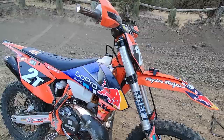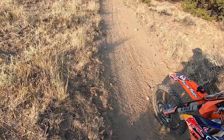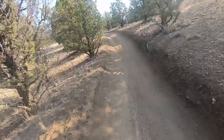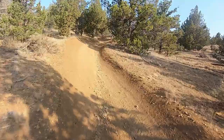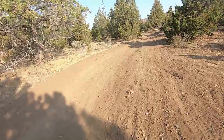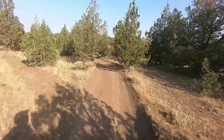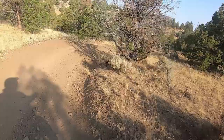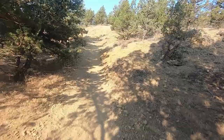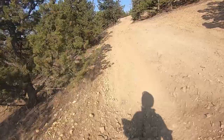I then took the bike out to local trails here in central Oregon — kind of double-track, open, sandy, rocky embedded-rock type riding, mostly faster with some technical sections, generally third gear and above. I stiffened up the suspension a little bit and it was awesome. The suppleness really shines when the terrain gets chopped up — the front tire just floats over things that I could never get the stock suspension to do remotely. The best I could do with stock was lower the air pressure in the front, which helped a little, but caused all kinds of balance issues when braking hard into turns. I just couldn't get the stock suspension to be supple and firm at the same time.